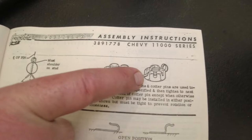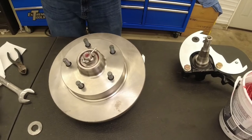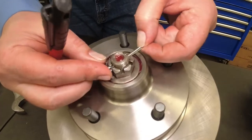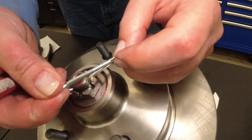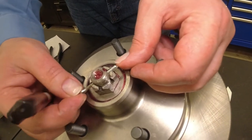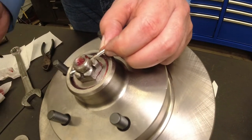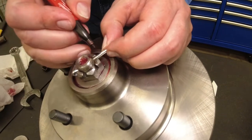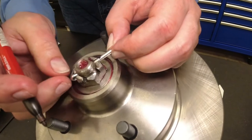The bottom one will stick out past the nut some and the top will bend over the top of the threads. To do that, what I like to do is keep the short leg that's already on the cotter pin. You have your long leg and your short leg. I keep the short leg where it was, push it back a little bit, spin it 180 degrees and push it all the way back in. I can then mark the long leg so it sticks out just a little bit past the nut — and that's the one I'm going to cut off.